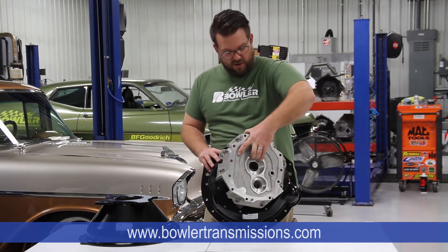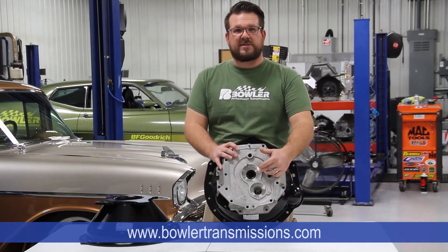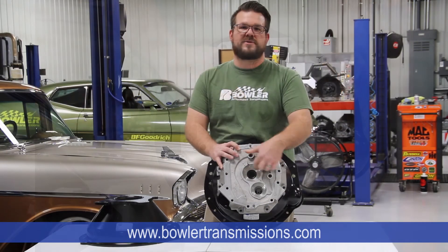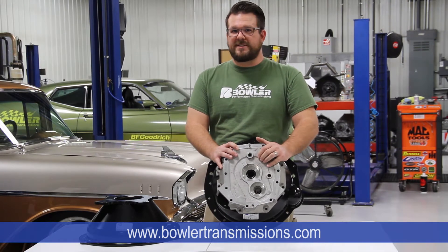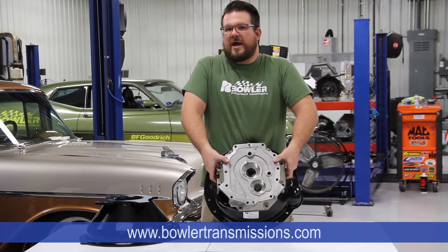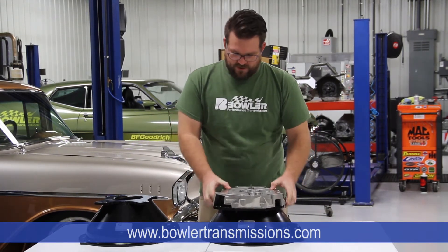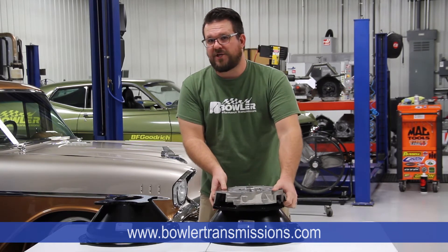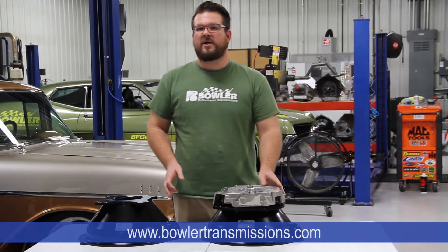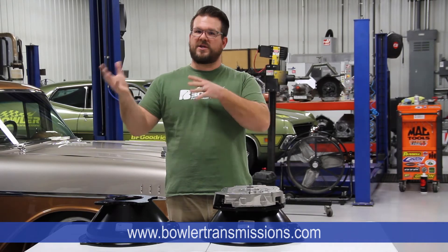Place the front cover onto the bell housing, and once we have that bolted up we have a nice concentric circle here where the input shaft comes to the transmission that we can take our measurements from. It's not a real easy way to go, but it's about the best way to do it. My only bit of advice is: if you have the engine out of the car, it's always ideal to do this setup at that point. In the video you'll see we're actually doing the alignment on a car that's got the engine still in it, so you can see how it can be done that direction as well.